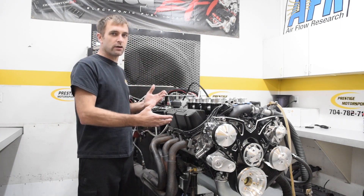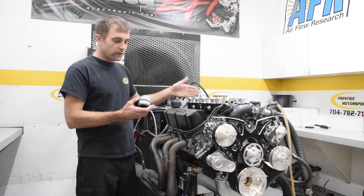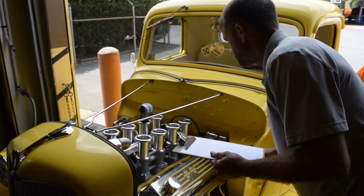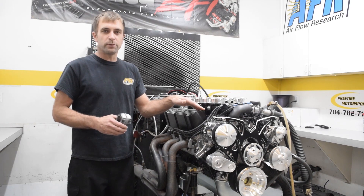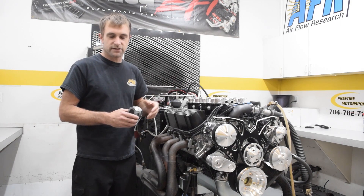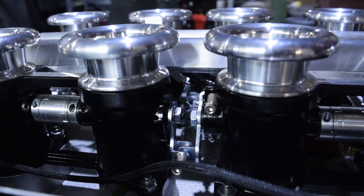After the engine is heat-soaked, settled, and we've made throttle runs, when we return to idle we grab the air meter again and pay very close attention to calibration — making sure it's the same on each side and from throttle body to throttle body. One thing about Borla and a few others: underneath is a common plenum that provides a vacuum area for the MAP sensor, but it also helps balance the throttle bodies from side to side, which makes it less tricky. The throttle screw has a spring on it to keep tension.